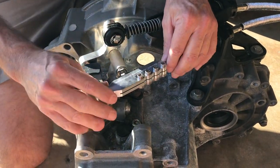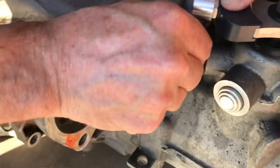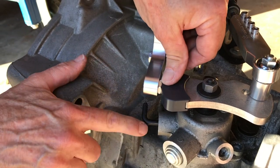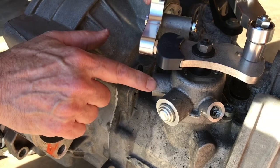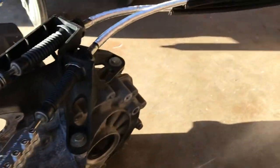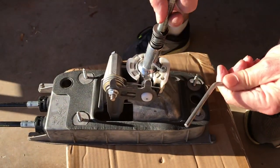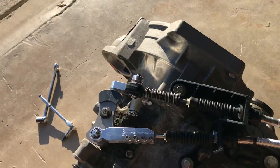So once you've done that, you can unlock the transmission, and that pin is right here. And so you're going to push down and rotate it counterclockwise, and then the pin comes back out. Don't forget to do this because you'll shear the pin off. So once you've unlocked the transmission, you go back in the car, inside the cabin, and then you remove the 5mm pin, and then you can go ahead and check first and second gear.